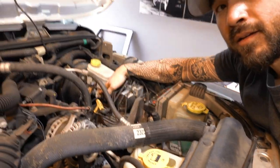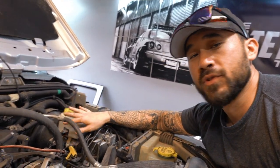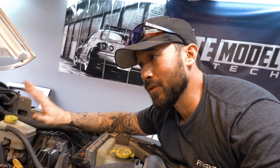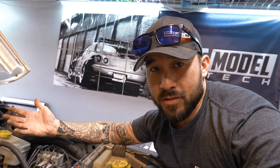So if you have a spongy brake pedal, your problem is going to be somewhere else. Look at things like the master cylinder — these can go bad, leak, and give you a crazy pedal that goes too far and feels super soft. Beyond that, it could be a bad caliper, a bad brake line, air in the brake lines, seized calipers, or you might not have any brake pads left — so the car doesn't stop and the pedal feels like it's not doing anything.